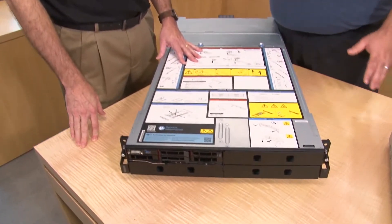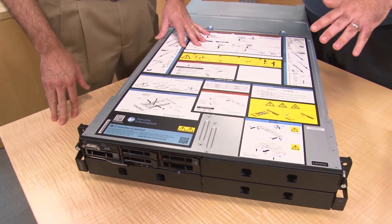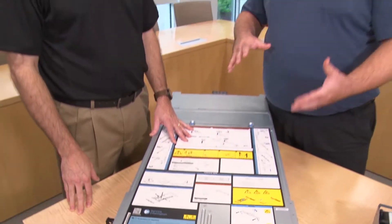The SD530 and D2 Enclosure are a 2U4-node system. Density Optimized isn't new to the market — there are a lot of 2U4 nodes out there, and it's not new to Lenovo either. We actually have a current product in the market today, the SD350 and our NextScale product line. What makes this a little different is the NextScale was a 6U high 12-node system, and this is a 2U4-node. You're getting a more digestible package, but you're getting the same density — basically the same amount of compute and storage that you would have in a 1U server in a half-wide configuration.